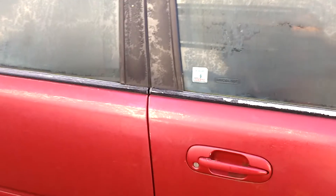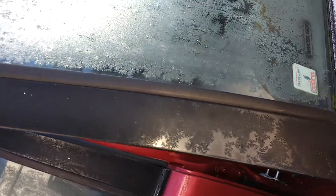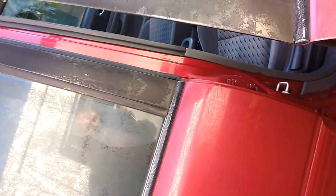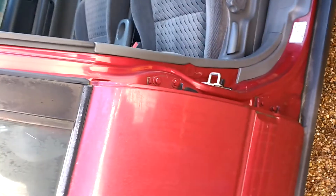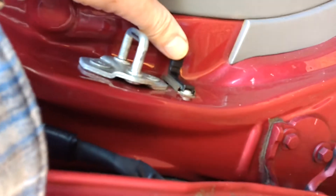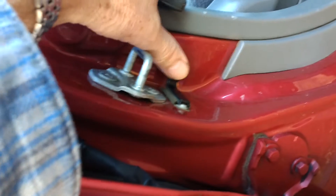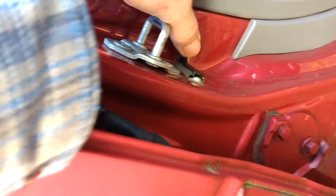You just unlock it, and then what you find is that even when you open the door like that, the alarm and the remote locking might reset, which obviously it shouldn't do. The reason usually is because you've got dirty contacts on the door jamb switch, which is this thing here. All you have to do to sort them out is just flick the switch fairly sharply like that.